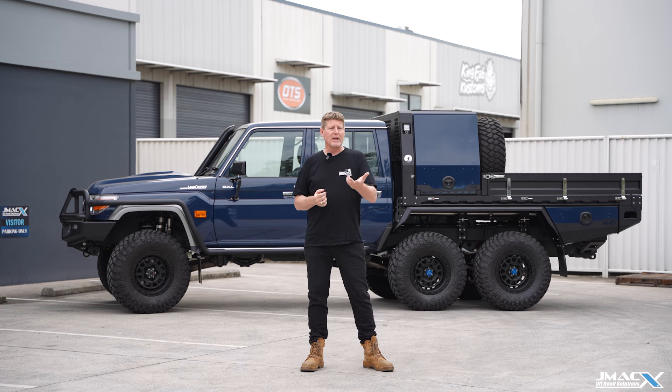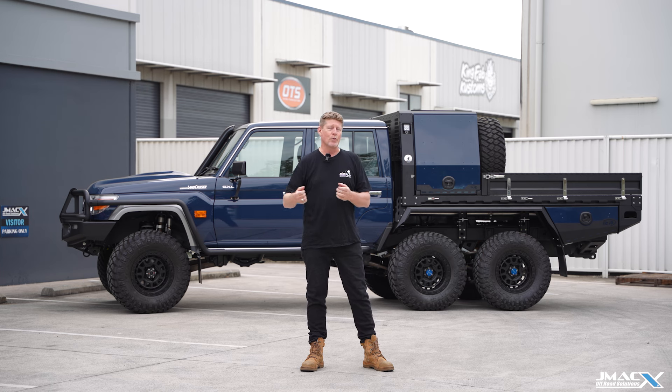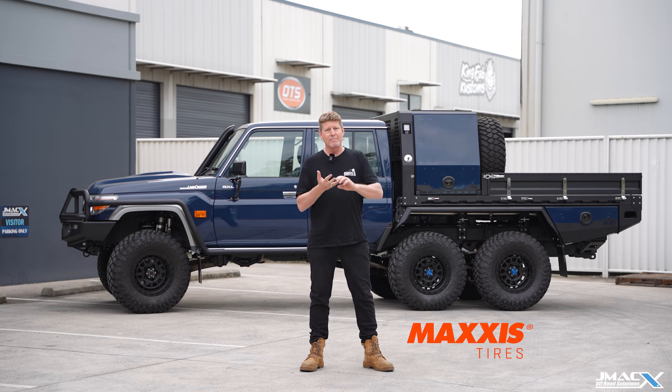These things are a four-and-a-half-ton tow, manual gearbox in this one. At 4495kg we can run a manual gearbox; at 5.3 tonnes in the truck space, also manual. If you want to go to 5.8 tonnes, you add an automatic transmission to get up to that 5.8t classification. These vehicles can be pushed from light to heavy quite easily, so it really comes back to what you as a customer want out of it — do you want it in the light vehicle space, put it into the truck space, or go auto up to 5.8t — all while maintaining a four-and-a-half-ton tow capacity.